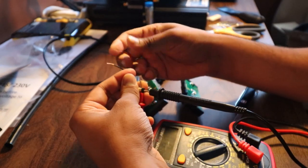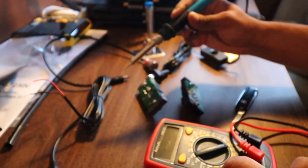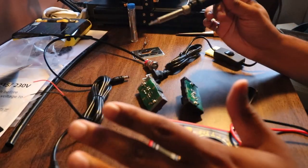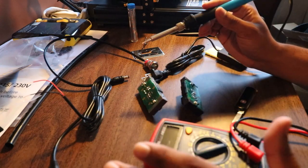I'm going to use this soldering iron I got off Amazon - it's definitely not that good and I haven't even used it yet, but it should be good enough just to do these two light connections I need. I highly recommend not soldering in a place like your bedroom like I'm doing. Make sure you have good ventilation, and if your solder material has lead then definitely clean your hands before and after - actually it's a good habit to clean your hands before and after when soldering anyway.